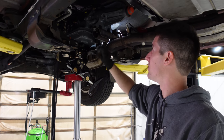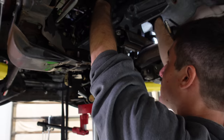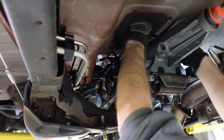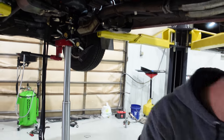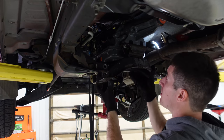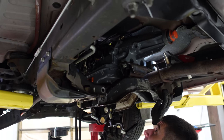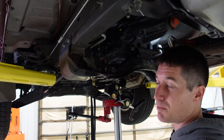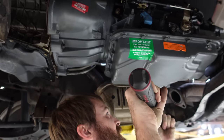The main thing is getting this transmission mount back in and the crossmember. I shot that back in and put the exhaust mount back on it. You can see it's hanging all by itself, but there's a bracket up here for all the wires that run across it, and you have to put these two gold nuts on those studs. Then you can start wiring the thing. I want to go ahead and get the crossmember in now just to make sure everything's good to go. We took the crossmember to the parts washer — if you remember, it was pretty dirty, and now it looks like nice bare aluminum. The arch goes backwards. There's also a sticker that says the pan bolts have to be re-torqued, so we're re-torquing all the pan bolts to 14 newton-meters, going all the way around.